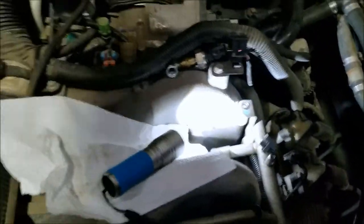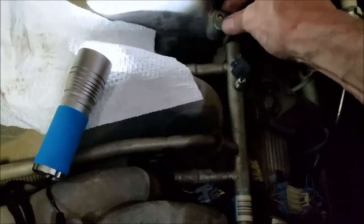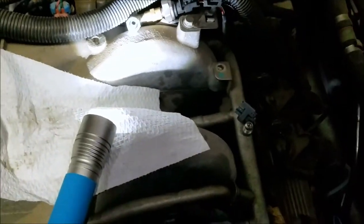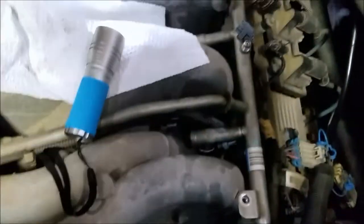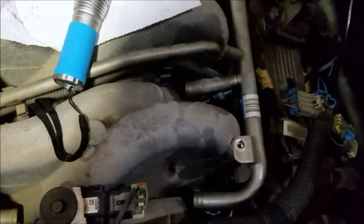I just got the injector put back in. What helped was putting a little Vaseline on the O-rings. Once I got them into place, I steadily wiggled it back and forth, put another little shot of penetrating oil, applied a little pressure on one end, worked my way across, and it all snapped down. Now I'm ready to put my bolts back in and put my clips in. I'll hook up the fuel line valve again and start it up. I don't expect any misfires yet because the engine is still slightly warm — I never get misfires until a cold start in the morning.